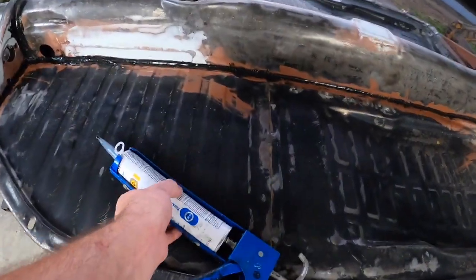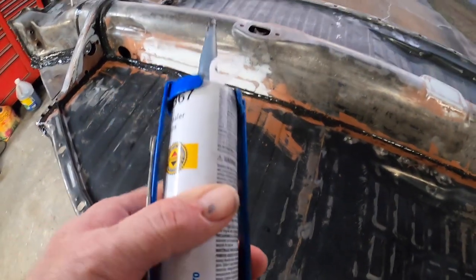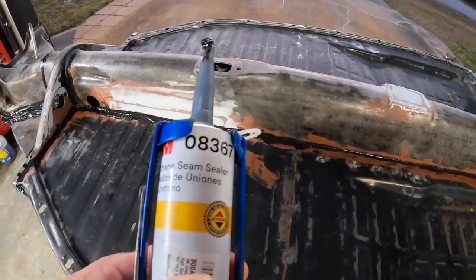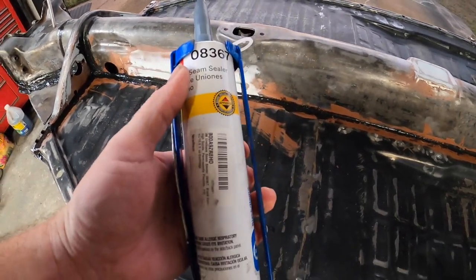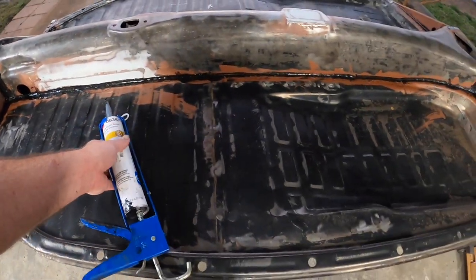Use a regular caulk gun with the seam sealer. It's the 3M 08367, the black seam sealer. So we'll let this dry overnight. It says it only needs roughly 30 minutes to an hour to dry. We're going to give it overnight, because tomorrow we're going to verify everything's good before hitting primer. See you in the morning.